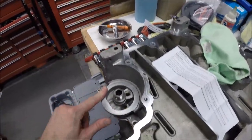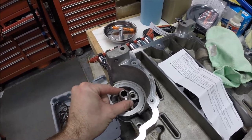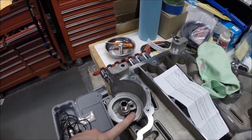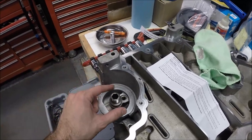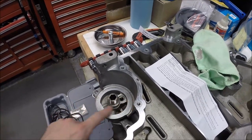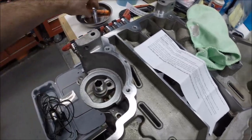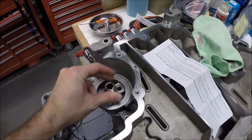If you're the sort of person that doesn't keep up with oil filter changes, or maybe in a situation where something catastrophic happens and plugs up the filter, then maybe that's a good thing. Following my failed engine, I found a lot of camshaft wear, and the metal particles from the camshaft were found not only in the oil filter but also downstream through my oil cooler. If the oil filter was working properly it should have caught those particles, so I'm suspicious that this bypass was opening and allowing unfiltered oil past the filter — that's how those metal particles made it downstream.